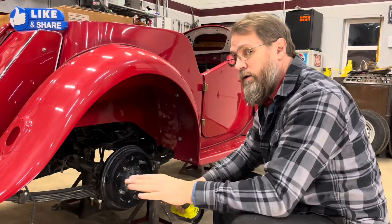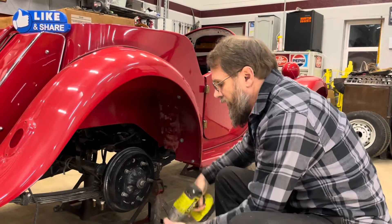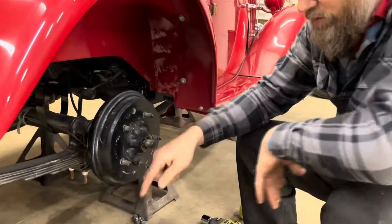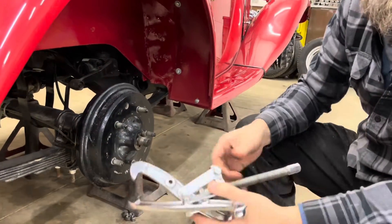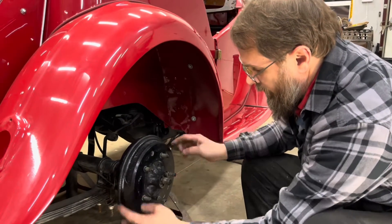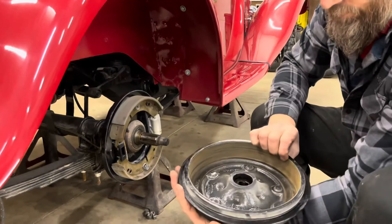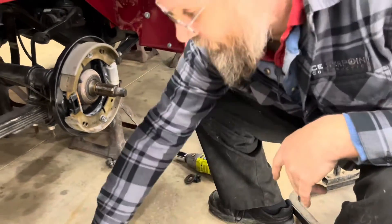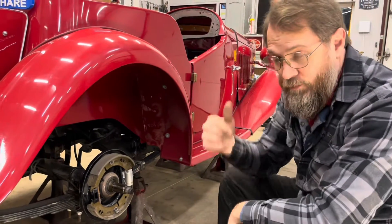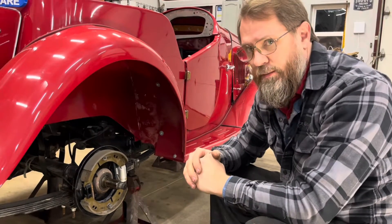An inch and a quarter SAE will work just fine on it - it's tight enough to not cause any damage. You've got to take the nut off and then this is a bit of an interference fit a lot of times, so if it doesn't want to come off, a three-jaw gear puller can get a hold of the edges and pull it off. This one's going to come off easy since we already had it off, but sometimes you'll have to pull them. We will definitely have to do the front. Back ones sometimes slide off easy, sometimes don't.